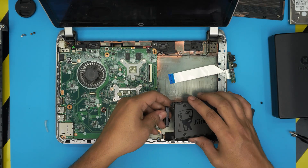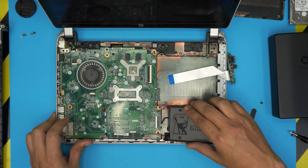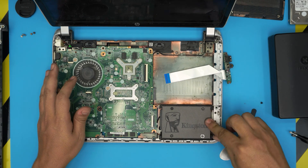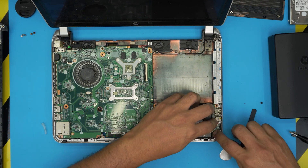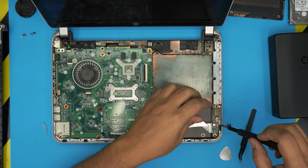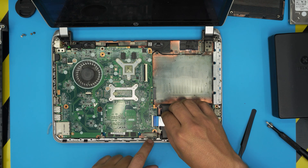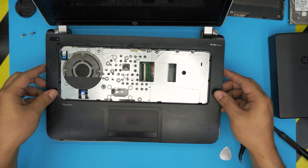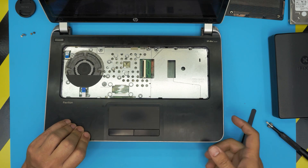Once you've got the hard drive ready, grab the adapter and push it in. Put this side right under the hinges and slide them down underneath, then slide it all the way to the bottom case. Grab the audio jack and push it in there, make sure it goes nicely in place, and put the one screw that was holding it. Open up the jack, slide it underneath, hold it and lock it down. Then grab the palm rest, bring it over 90 degrees straight on top, push it down, and pinch the bottom and top cover — make sure you hear those click sounds.